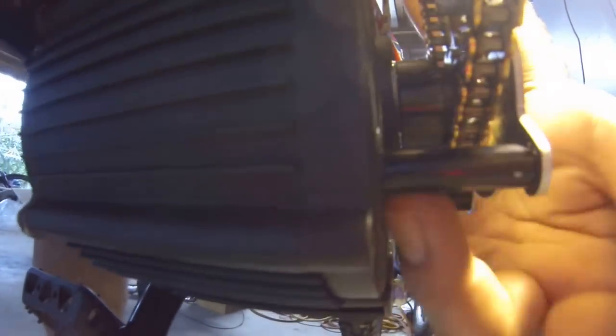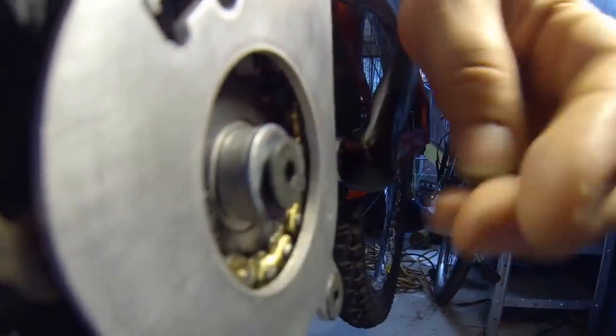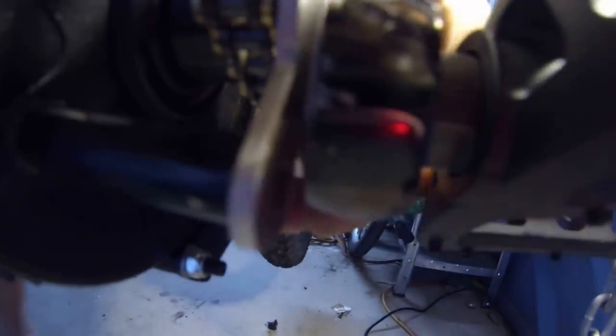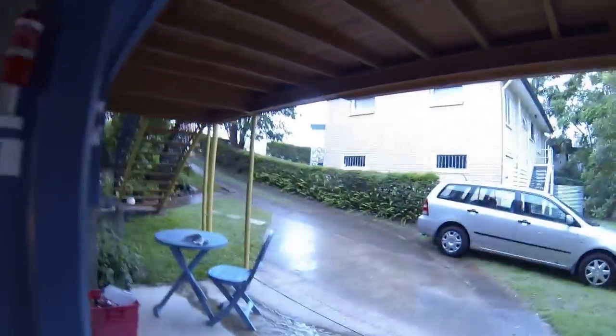This could be bent out a little bit - it was kind of bent already. I'm just explaining what I've been doing. I sanded these - I think they're called bushes - just a little, filing them in on the edges so the guard could go inwards. The foot was hitting when I had it tightened how I wanted, but just a little bit looser it clears that fixed point by that much. If I need to file more once I put pedal pressure on it, I will do the inside of the cranks - you can see they're looking a bit silver in there. I've got miserable weather so I can't even go for a test ride - bummer - but very happy to have it running. Thanks Mike.